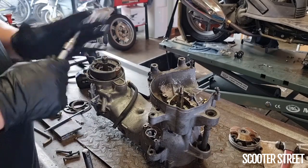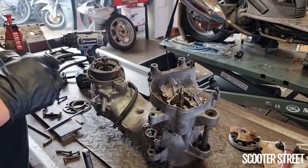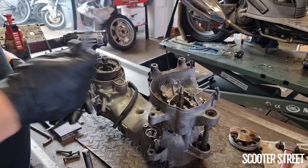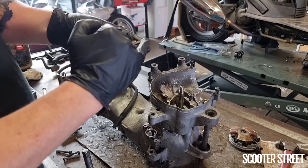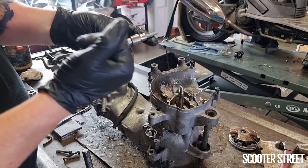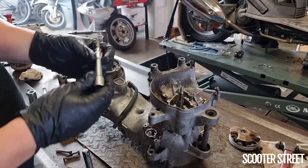So the biggest thing, like I mentioned, once it happens once or twice, you immediately stop, and you need to address it a different way, otherwise you're going to continue having the same problem. So what I've done is flown down to the shop and gotten myself a brand new 5mm hex bit. Because it's brand new, it's got really nice fresh edges, which is what eventually wears on a hex bit. So these are beautiful, nice and fresh and sharp.